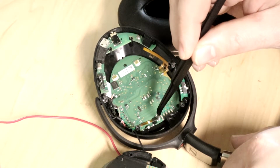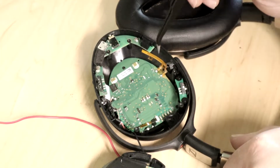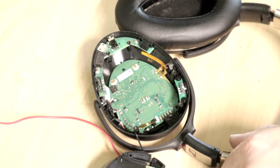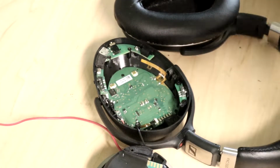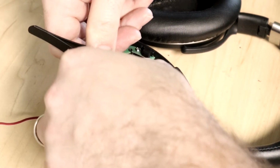But I guess one side of the switch is also on this little point, and the other side, which can be a good connection for the ground plane, is over here on this nice open plane that you can actually connect to. So it seems one of the easiest ways to fix this is to bridge those 2 points right there. Before I start messing with anything, let's just test it and see if it works. I started with tweezers, and then I got some wire to do it, and I was connecting it, and nothing's happening.